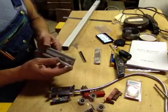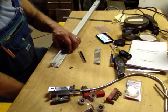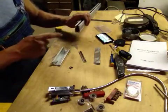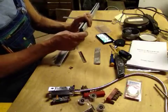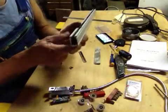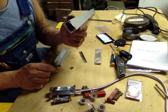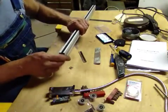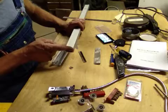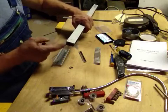There's a little piece of glass that was still stuck in there and I didn't try to remove it — you can probably see that. So what I ended up having to do, since I couldn't get the glass out, was first I took a hacksaw and very carefully cut down from the top. I had this clamped in a vise with some padding and cut very carefully down from the top, stopped short of the glass, which is inside there. Then I laid it on the side and cut down very close to the glass in both directions. The only thing that was not cut was the back side, because I didn't want to hit the glass.